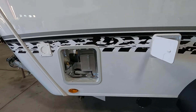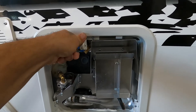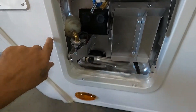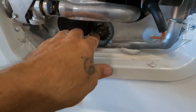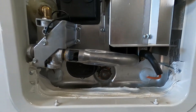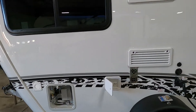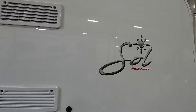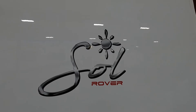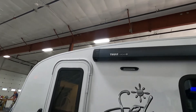When you're done camping for the season, come over to your hot water heater. Lift up on this pressure release valve — that's going to dump some hot water out of there, so be careful. Push that back down, otherwise your door won't close. Then remove the drain plug — again, be careful of hot water. We thank you so much for your purchase — hope you enjoy the Sol Dawn for many years to come. Happy camping!